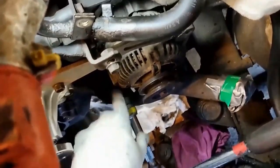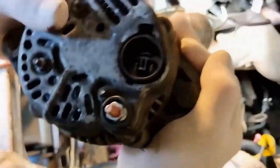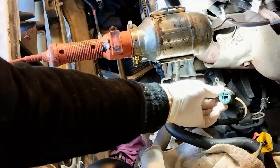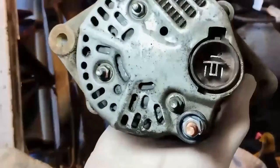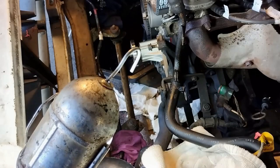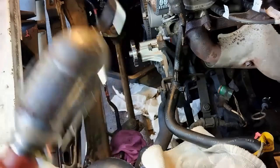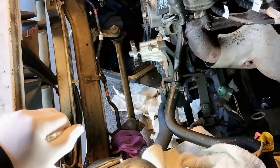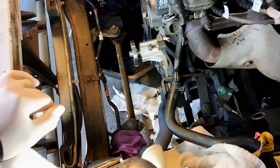Now it's time to remove the alternator and put the new one on. I've got a socket on there and a wrench on the other side to remove this bolt. This alternator is about seven or eight years old, maybe. I did notice a little bit of corrosion or white rust here on this plug - the plug looks good. I was getting a 12 volt reading while driving the car, which usually means the alternator is not good. There should be a 14 volt reading, but now is as good an opportunity as any to replace it.